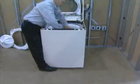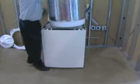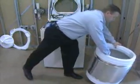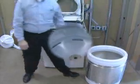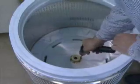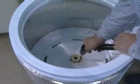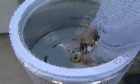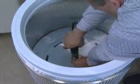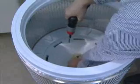Carefully lift the basket out of the washer. To remove the basket hub, remove the 6 screws securing the hub to the basket and lift the hub assembly from the basket.